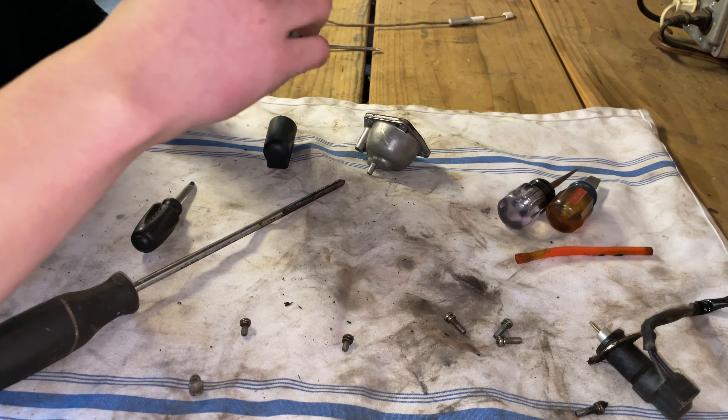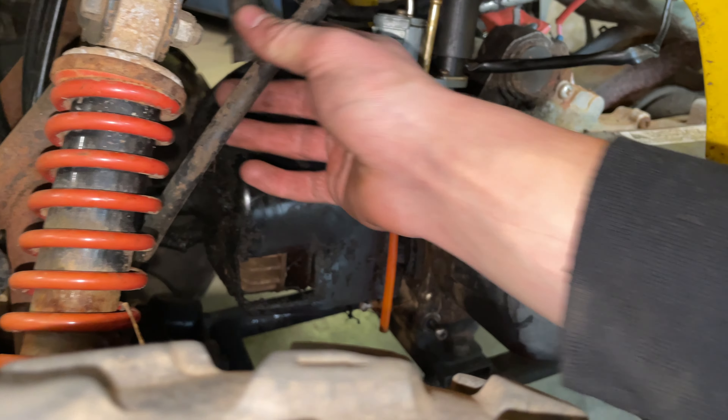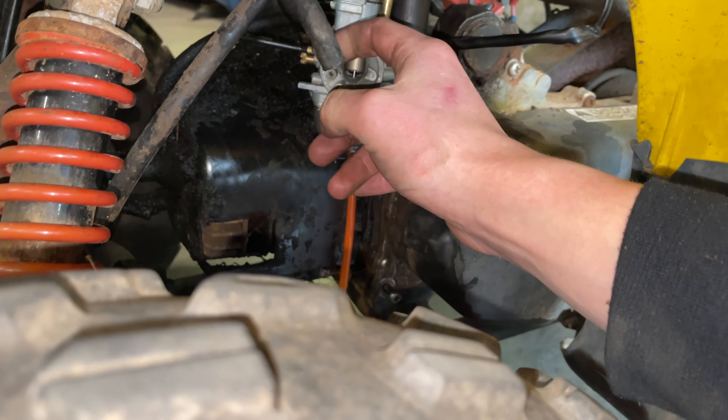I should probably clean all this. Just did the good old ether rebuild and she's brand new. Go ahead and throw this back on and see if it'll get fuel now. The carb's all rebuilt, put it back in. I honestly think now I'm gonna try to drain all the varnish out of that tank — if we can get that to work, that would be awesome.